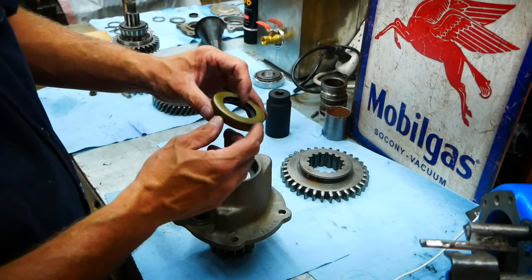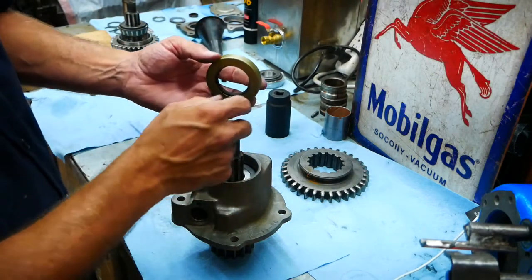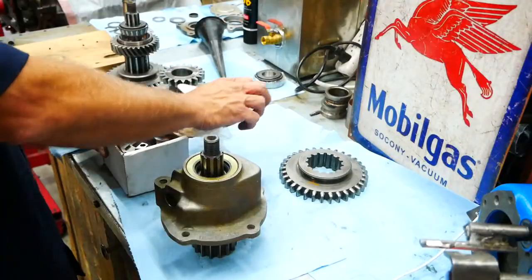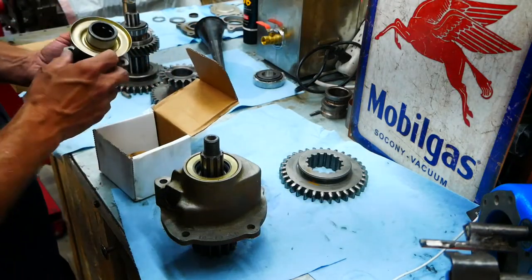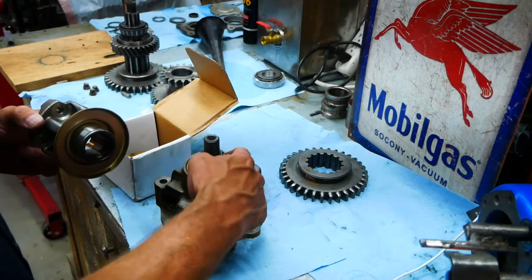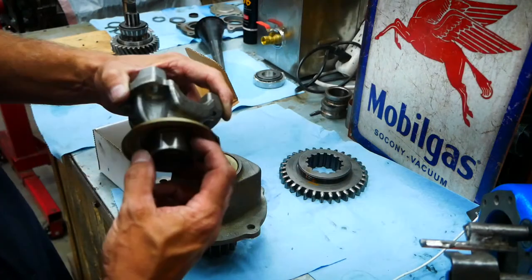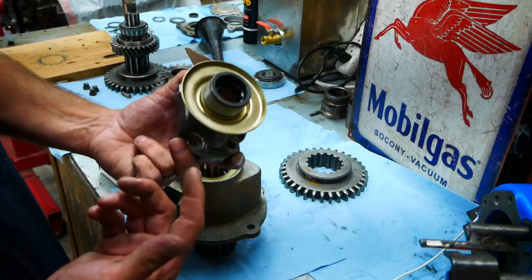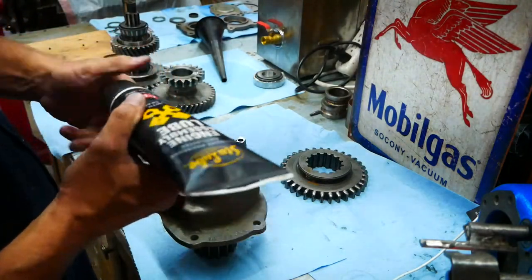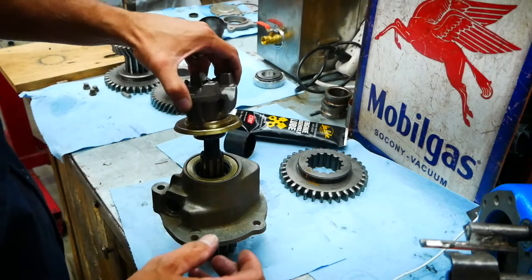I'm going to go ahead and put the gasket — there's a felt gasket that comes in the kit, make sure you stick that down in there first. Then we're going to drive on our seal. Make sure that you've got it pointing in the right direction so that the yoke can go right down in there past the flange. We have new Dana 20 yokes. The reason why you want to buy new yokes is that road grime gets into this seal and acts like a grinder, creating a small lip which will actually cause it to leak. Before I put this in the case, I'm going to put some lubrication on here so I don't damage the seal and it doesn't start up dry.